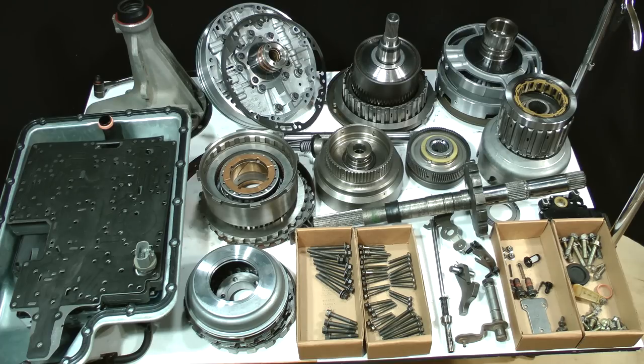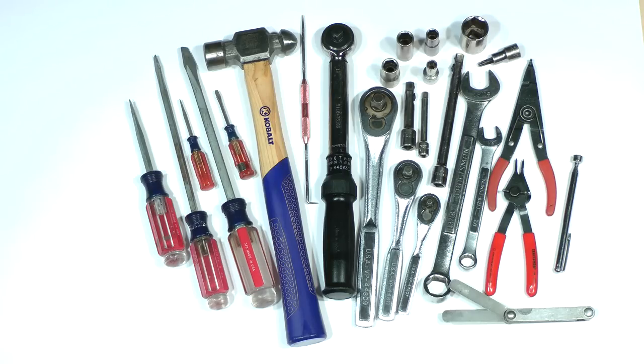Now let's take a look at the tools we'll need for this project. You don't need a lot of hard-to-find or expensive tools. There are tools specifically designed for working on transmissions, and while they are nice to have, they are not absolutely necessary. Here are the only hand tools you really need: various screwdrivers; a hammer — even a claw hammer will work fine; half, three-eighths, and quarter-inch drive ratchets; extensions; 8, 10, and 13mm three-eighths drive sockets; 13mm and seven-eighths half-inch drive sockets; a T30 Torx bit socket; half and seven-eighths inch open-end wrenches; feeler gauge set; common snap ring pliers; and a mechanic's pick.